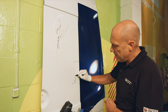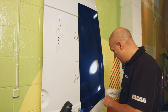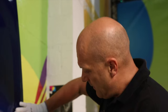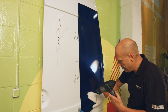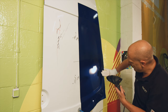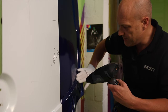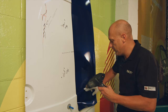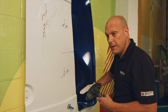I'll demonstrate two versions — the old way and the new way. Let's start with the old way, which is what everyone normally learns: heat up the recesses. I make the whole critical area hot, which is what everyone does. Little by little it goes down, but of course it's stretching too in the edge — exactly in the recess. So this is the normal way. There's a lot of tension, and the risk of it lifting is big because it's so much stretch.